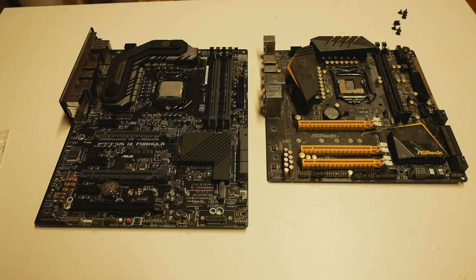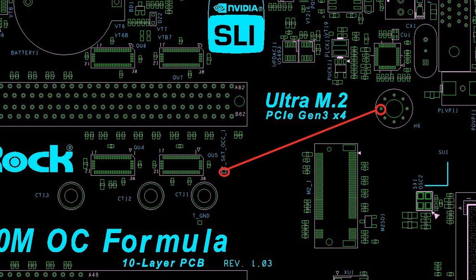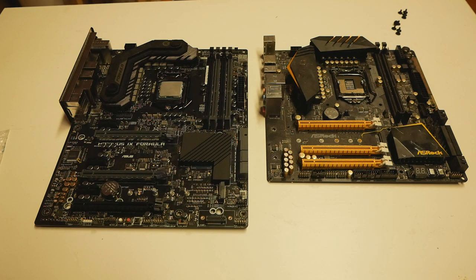But even then, they were easily accessible at the forums, and it was very easy to set up those modified BIOSes to the motherboard. You just had to flash the BIOS, set up your CPU in, and pretty much go and run it as if it was a Kaby Lake or Skylake CPU. You only had to do those simple hardware level modifications to the board in order to run those CPUs: short the two specific golden contact pads underneath the CPU, or find the same modification on the motherboard itself, so that the board will turn on when you press the power on button on the motherboard.